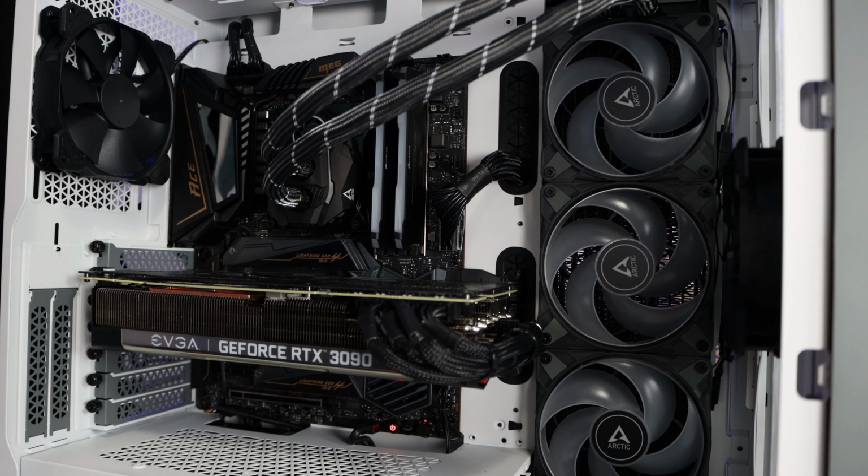All right, so now in the new BIOS, we'll go over here and just turn on XMP. We'll come down to memory. We'll see here 32 gigs, 32 gigs. It is 64 gigs of 3200 megahertz. All right, so that's all good there. Storage, these are the 2 SSDs, and these are the 3 M.2 SSDs. So beautiful, everything is showing up.